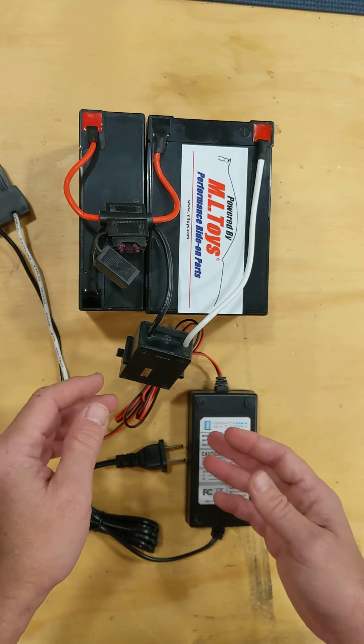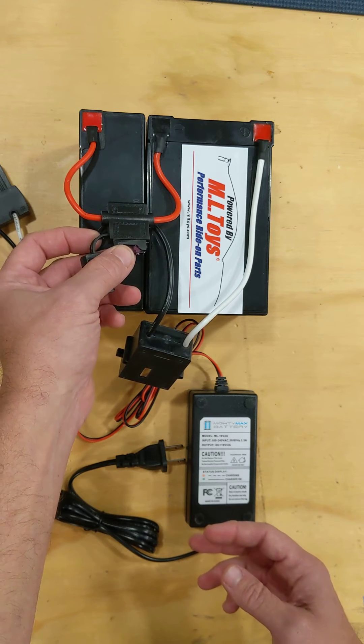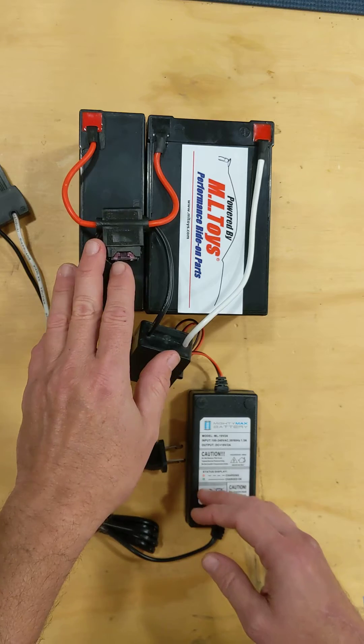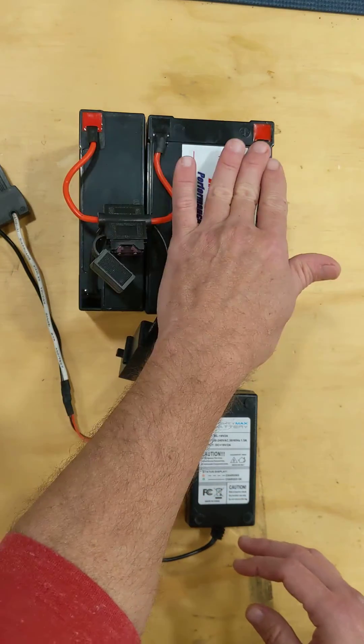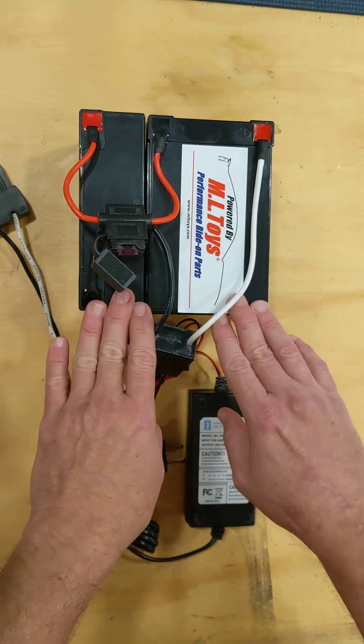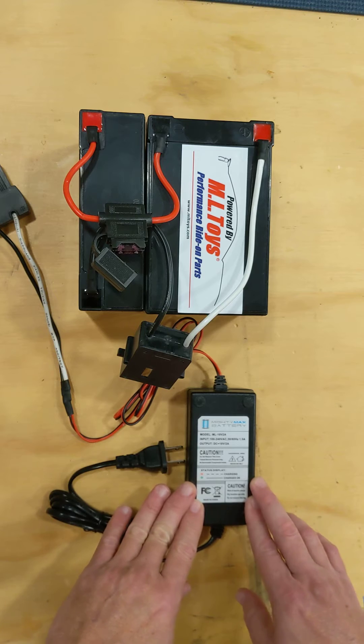What can that be? Well, first thing you'll want to do is check the fuse on the battery, see if that's good. Check the outlet — make sure the outlet is working in your room — and then make sure all your connections are attached. If it's still not reading anything, the odds are your battery has discharged so low that the charger is not going to pick it up anymore.